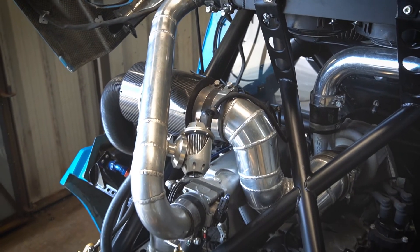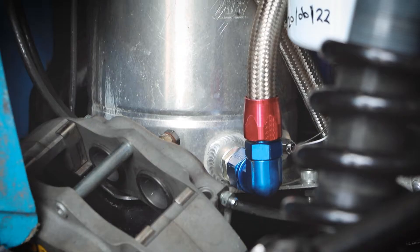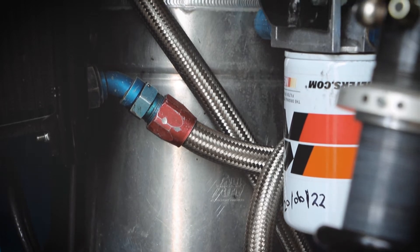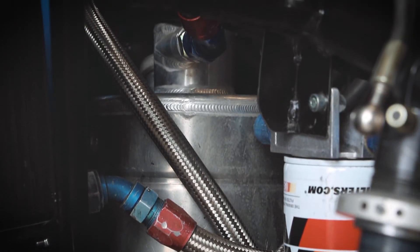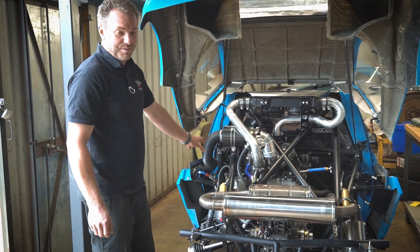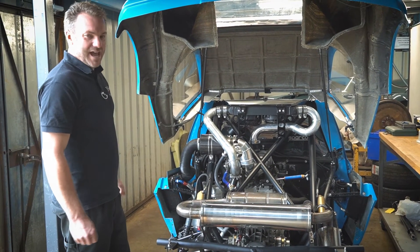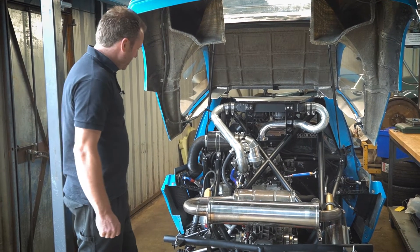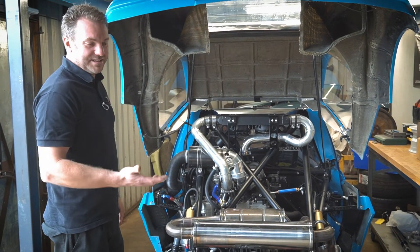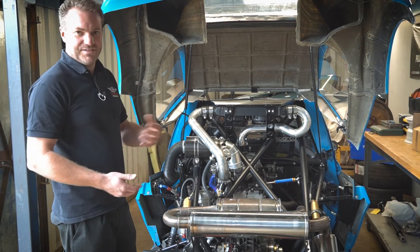We've re-plumbed this slightly to give it a better path. We've also added an engine oil cooler that cools the oil as it goes back into the dry sump tank. A major upgrade is a multi-stage dry sump pump — it's got a large pump putting oil into the engine and three large scavengers taking out a mixture of air and oil, putting it into the dry sump tank. We've also added an idle up valve, so when he's in the pit lane he can switch it on and raise his idle so the car doesn't stall easily, because a racing clutch has a bit of a tendency to stall.